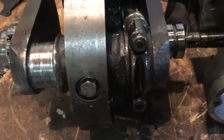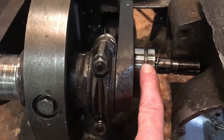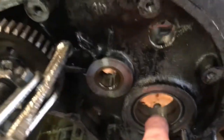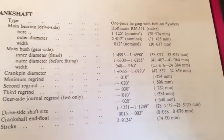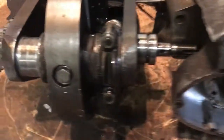Looking at other areas, the two main bearings are actually in pretty good condition. On the timing side you've just got a journal on the crank here, and that is well within tolerance. Similarly within the motor, the shell itself shows a matte finish — it shows a little bit of roughing up — but actually it's within tolerance. It's measured up well, and all these tolerances and measurements are given in the workshop manual. So that's pretty good news — I think the main bearings have survived.